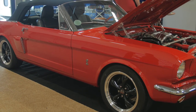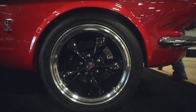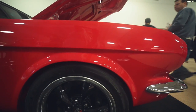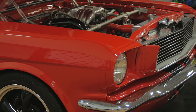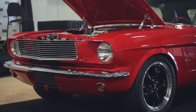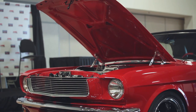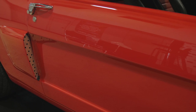On this one, we used the Spies Hecker color prime system, the Valspar. It's really good, actually. Good coverage, it helps you when you're going to the base process, less coats. We did a custom stripe. We painted the whole engine bay with single stage, which worked really well to give us a little help in the whole coverage area.